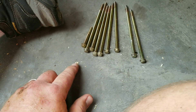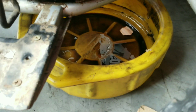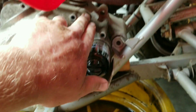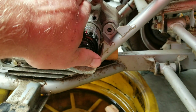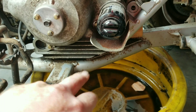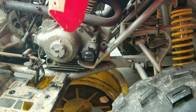There is one short bolt in the bunch - it's the one that comes out near the starter, right below it. All your bolts have 8 millimeter heads, and it looks like we've got nine of them that have to come out. I'll tap from the other side on this tab - I'll probably come through with a 3/8 inch ratchet extension. We'll find out if some of these other bolts need to come out. Alright, I'm ready to tap from the other side - let's see what happens.